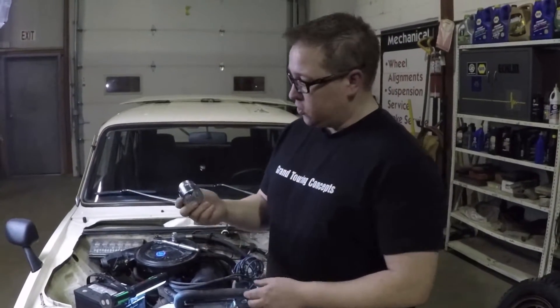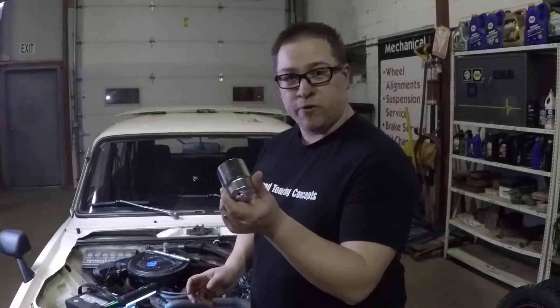Well, Richard, it's a pretty simple thing to do, as you've seen, but there's a trick. On the crankshaft, you'll notice that there's a large nut. This one's a 38mm, and a socket like this will fit perfectly.